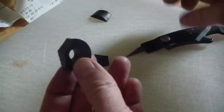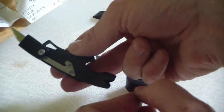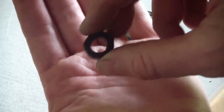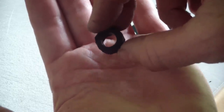I'm also going to shave it down in thickness — this is where an actual thick razor blade would have been handy. I'll cut it down to make a small circle, then slice the back off. This is the Gerber Artifact tool, a keychain knife with an X-Acto blade built into it. It ended up pretty small — I'm not going to win any Engineering Excellence Awards — but it's right about the right size. I cut it a little bit big so it'll stick in there and stay rather than being too small and hopping around, and I trimmed the edges to make room for the washers and retaining clips.